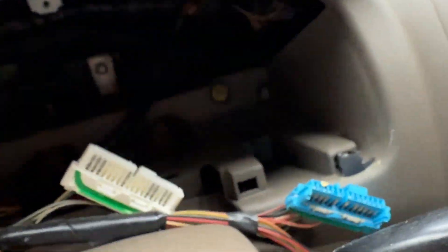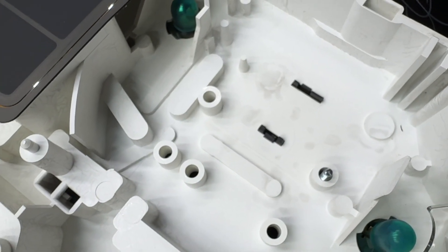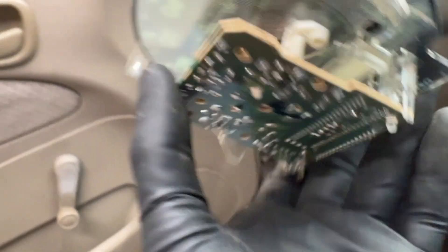By the way, there are two screws right there — you see the holes that hold this hood in. Be careful, mine's brittle because it's a Southern car and that bottom piece cracked off. Then there's a screw dead center of your screen, and then on that silver tab to get out this assembly. On the back of the assembly are a couple of screws — all five of those holes have screws and then the speedometer assembly just comes right out.